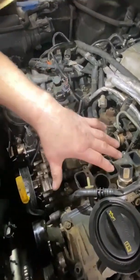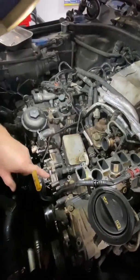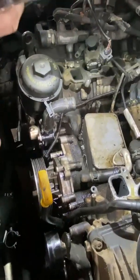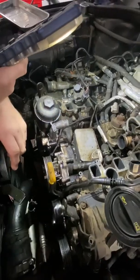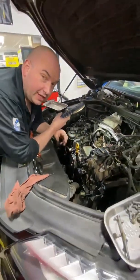the valley here, because this has the EGR cooler on it, the intake plenum and all that, so you'll get coolant and that running out through the corners of the valley. That's the indication there. So we're going to get the rest of this all apart, and we'll follow through with another video and give you a better idea of how really involved this job is.